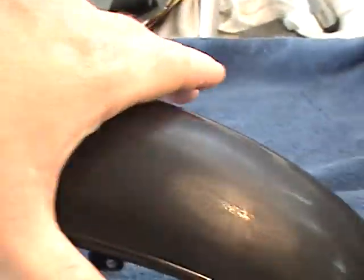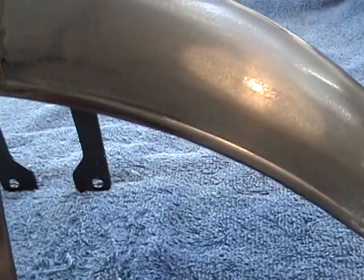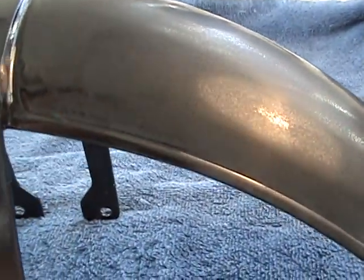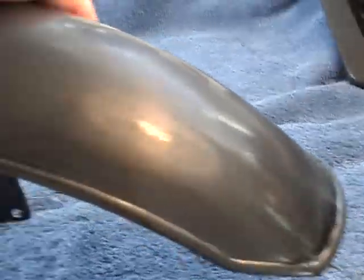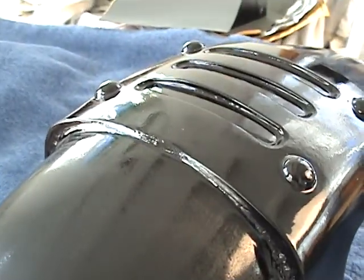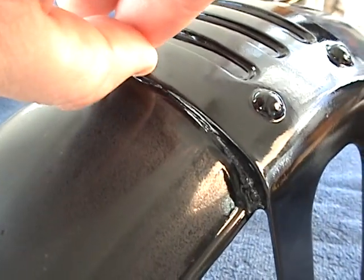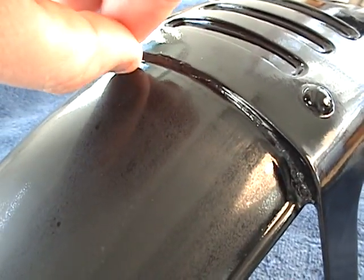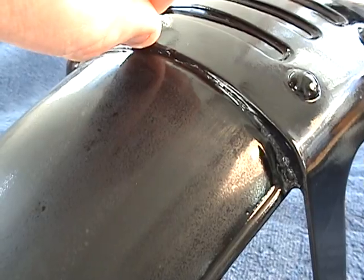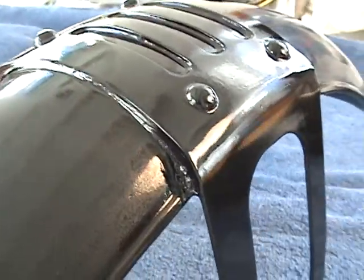But if you go and start to work on your sanding, you're going to put more pressure on this edge. Remember what I told you about edges. They're thin. So stay off those and up here. And also be very careful around this edge right here, this metal edge. You want to stay about an eighth of an inch away from there. Always. Because the paint's very, very thin right there. And once you go through it, it's just a bitch.